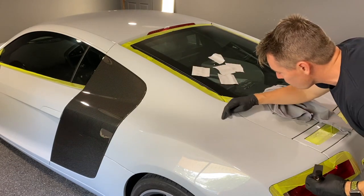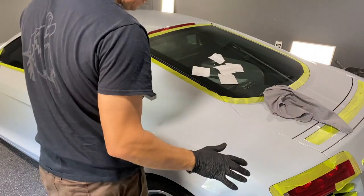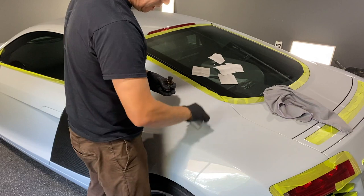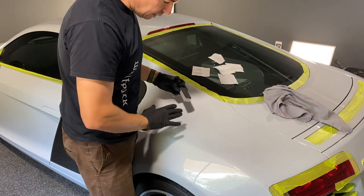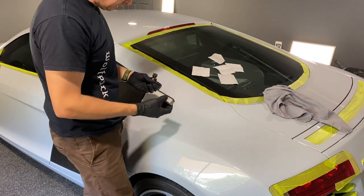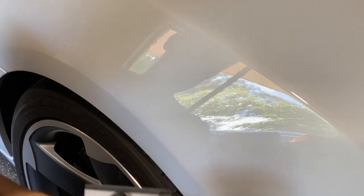I can feel a slight difference and I'll use a second cloth as my secondary buff just to make sure it comes off as intended. The instructions are very clear: don't leave it on for any more than two minutes in total. Work small areas, smear it around up and back, then leave the next panel a little longer to try and let it dry off a touch. The instructions were very clear about not leaving it too long.